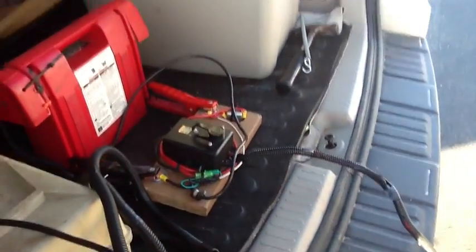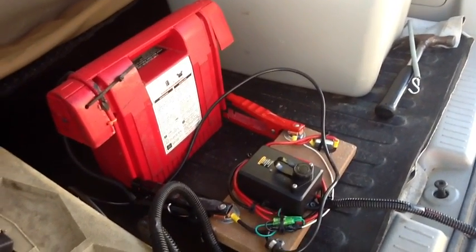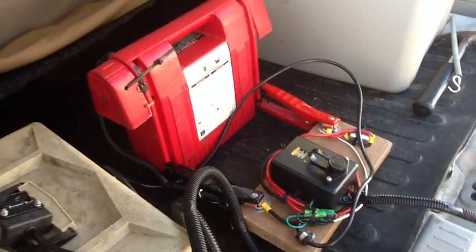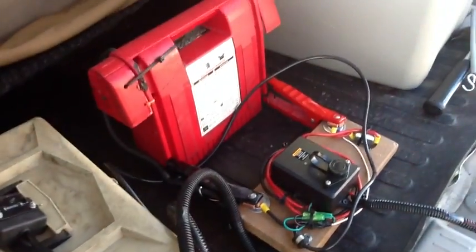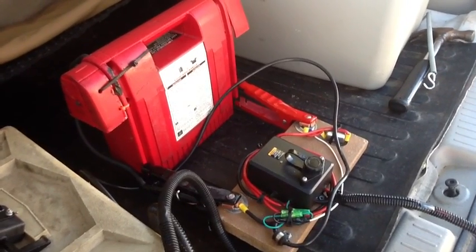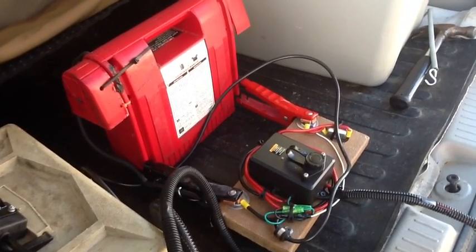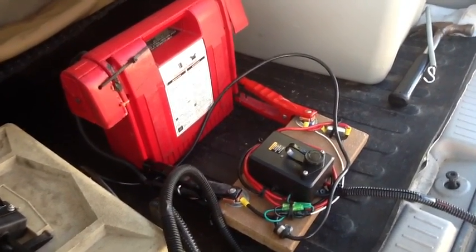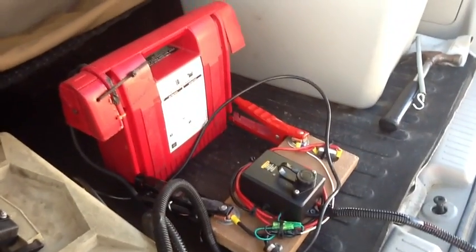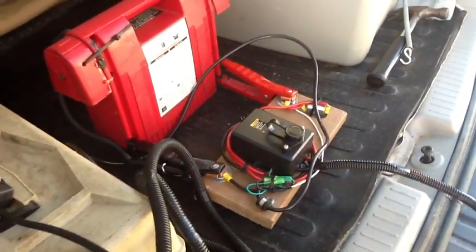This is another unique aspect of my application. Not only will it fit on any vehicle with a trailer hitch, but instead of running heavy six or eight gauge wire all the way from the front of the truck, I power mine off of one of these jumper battery boxes. We used one of those at the dealership on cold Iowa winters — we'd sometimes go out and start twenty or twenty-five cars off of one. The winch I purchased is off of an ATV with a small motorcycle battery, so it has plenty of power for what I do. You're not going to plow all day with it, but to keep the driveway and alley clear, just put that in the back of any pickup or SUV, hook up the electrical, and you're ready to go.